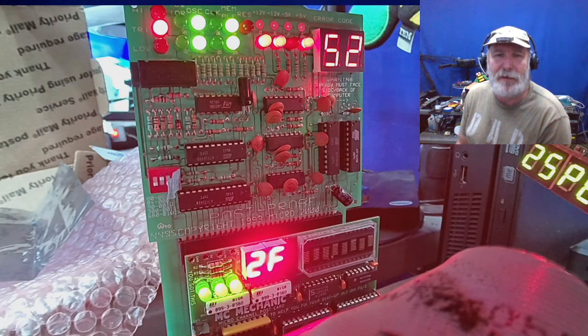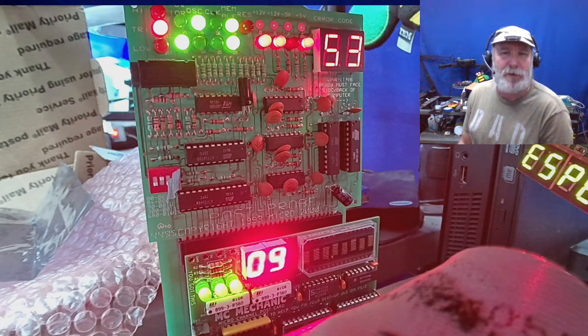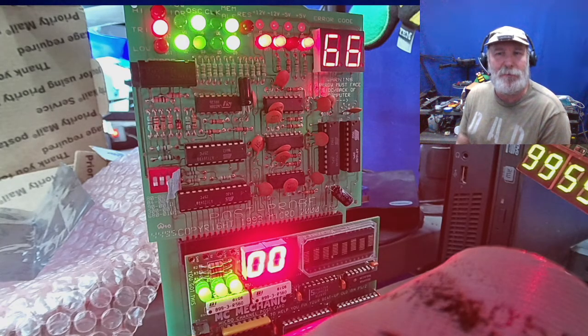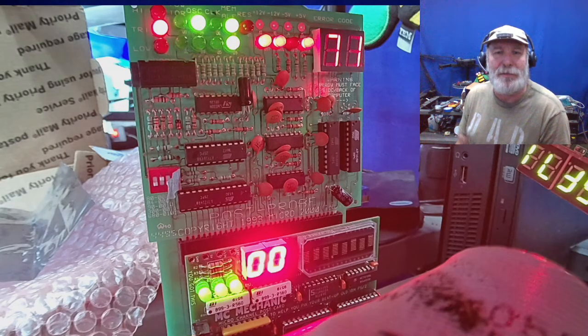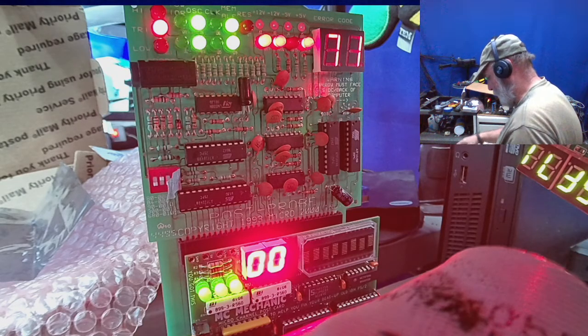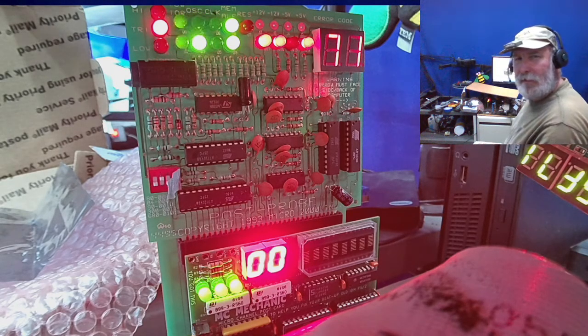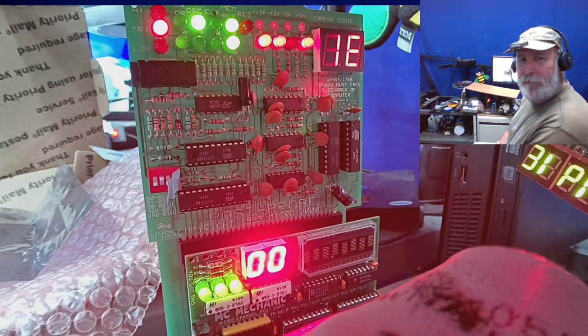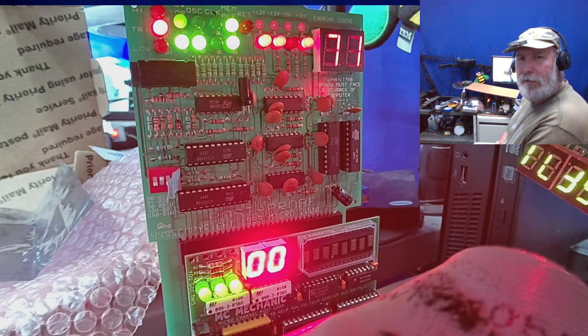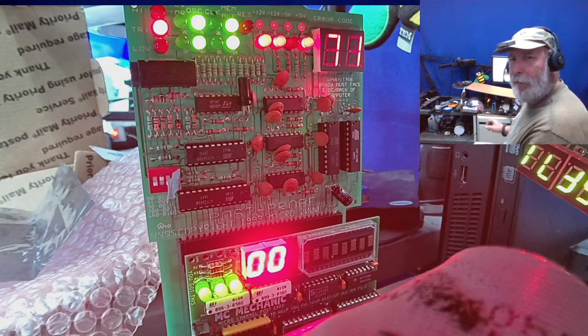So do you see that? How that is flipping over, probably in memory checks. It has the primary postcode for that primary port, the 0680, and then kind of the subroutine of the other check. And I want to do that. If we do a control delete, it should still go through the postcode. So it gets up there, and of course it just says 00 for a lot of it, and didn't go through the memory check.